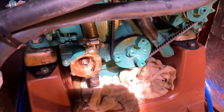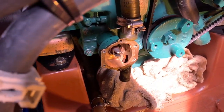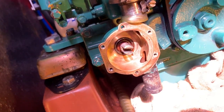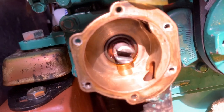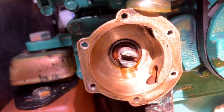I've had a small water leak from the little weeping slot here at the back of the pump. It's between the two seals — the sea water seal and the oil seal. The sea water seal is the one you can see here around the spindle, and as you can see, it's very, very corroded inside. The spring that holds the seal onto the spindle has rotted away, so I need to replace that seal.